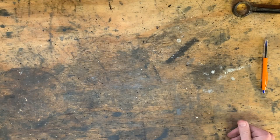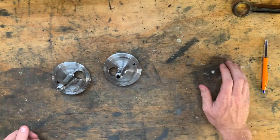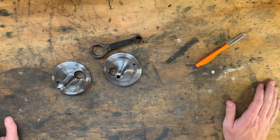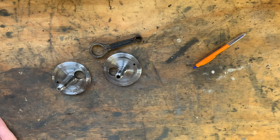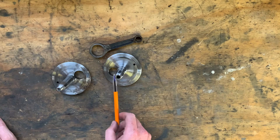This week was nothing but problems. First off, we have the crankshaft — I got the crank apart successfully. Here's the junk rod, and these two holes here measure 23.03 millimeters. The pin, which I measured with a mic, was 23.10 millimeters. This is all fine and dandy except on Procross's website they list the big end pin for the CRF50 and the Honda C50 as 23.00 millimeters. So I've emailed them to confirm this and take a bit of confusion out.